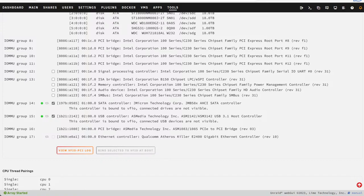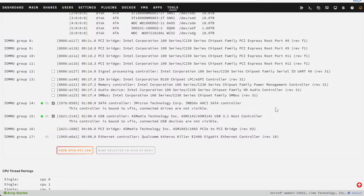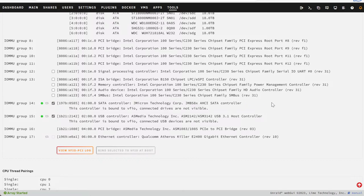Okay. Also, at the moment, since we're using Windows 98, this is kind of useless because I would have to have Windows 98 drivers for this SATA controller. Yeah. So we're much better to use an emulated CD on IDE bus. Right. Okay, so I am going to leave this here for now just because that's how I've been doing a bunch of ripping was with VMs, but I will change that in the future. So nothing else to prepare for now, just power off the machine, right?